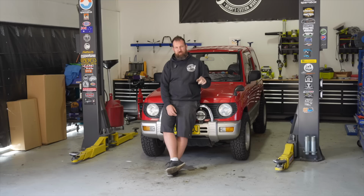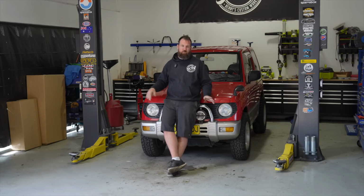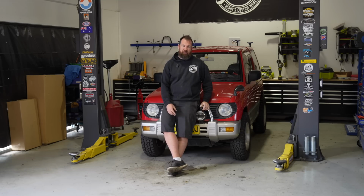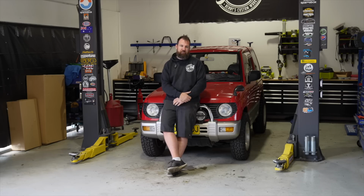I worked out that was about 80 mil lift just in suspension alone, so the CVs really weren't happy. I've currently got completely standard suspension in this. However, I do have a set of 30 mil raised springs that are going to come from Japan. Oddly enough, also, I did work out the right hand front is 20 mil lower than the left hand front. So there's obviously some weirdness going on with the springs there, either in the front or the rear springs, because it is worth thinking too that potentially the rear spring height is actually what's pushing more load on that front corner. Now, I don't think it is that, because it is quite a large difference being 20 mil left to right. That rear spring would have to be so far out. However, if you're playing around with your car, it is worth thinking that it's not always the corner you're working on that is the result of the ride height issue you're chasing. But I guess that's another story for another day.